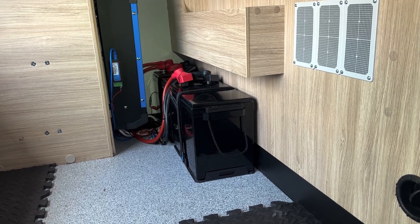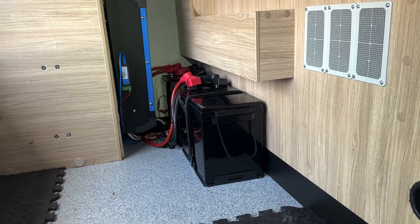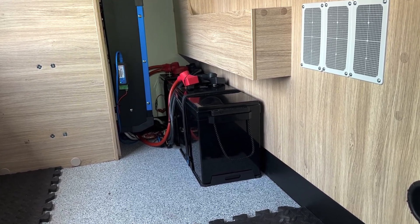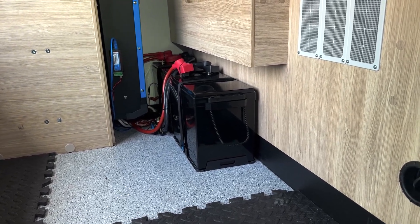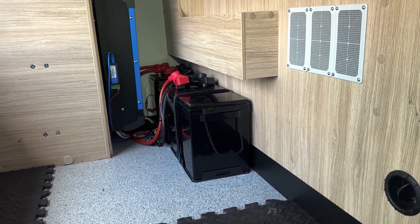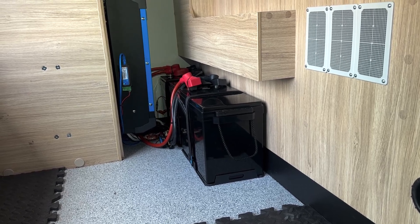You also save quite a lot of weight. This would have run the full length of the vehicle — a solid five metre run. Although technically possible, it wouldn't be ideal, and you'd add at least 30 kilos because you'd have four five-metre lengths of 50mm cable. This does bring weight towards the rear, but the customer mentioned they have air assist suspension on the back and were looking to update the van anyway.